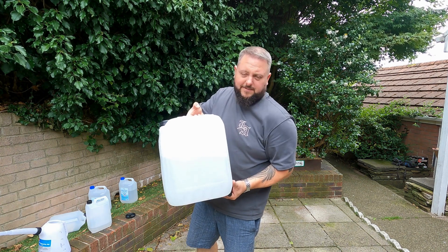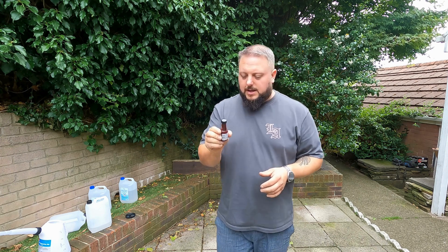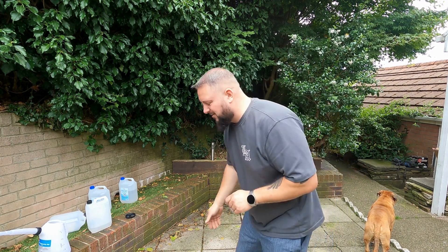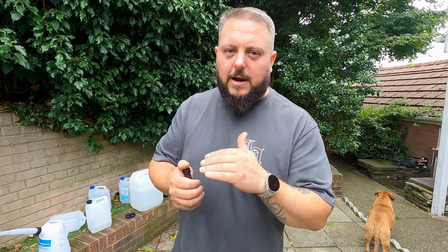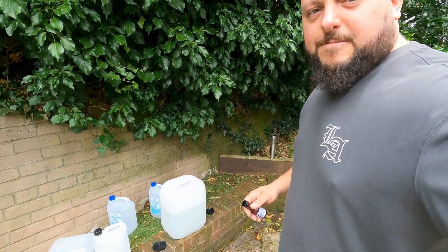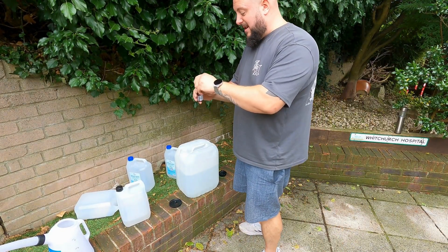There we have our 60/40 blend — 15 liters. As you can see it is clear. In the actual back of the car the bottle is a bit more frosted, so it's harder to see the level. What they recommend is a couple of drops of food coloring. Some people say it messes your lines up, but I can't see how a literally tiny amount of food coloring would do that considering the volume of fluid. The other alternative is a colored ping pong ball that floats in the tank.